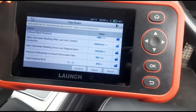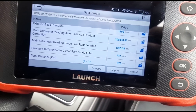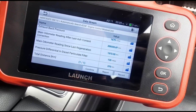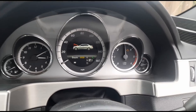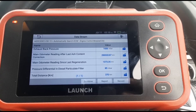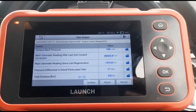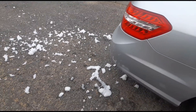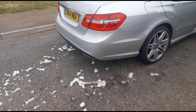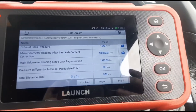The engine is running. I'm using a laser pedal depressor to hold the revs up. We're watching the DPF pressure come down — 200 millibars, then 140 millibars, coming down nice and quick at around 3000 RPM. Now down to 80 millibars. We can see suds coming out and then some vapor, which is basically steam from the exhaust heat burning off the fluid. Down to 66 millibars now.